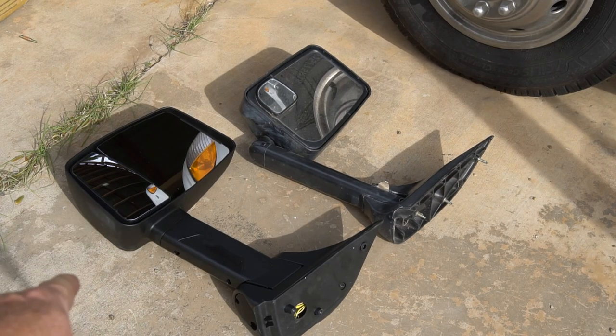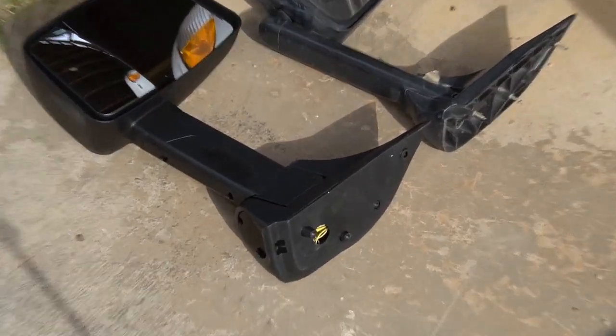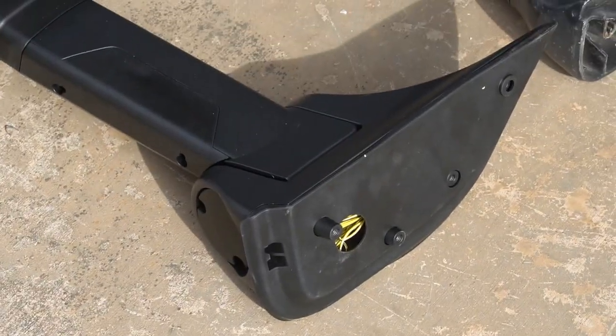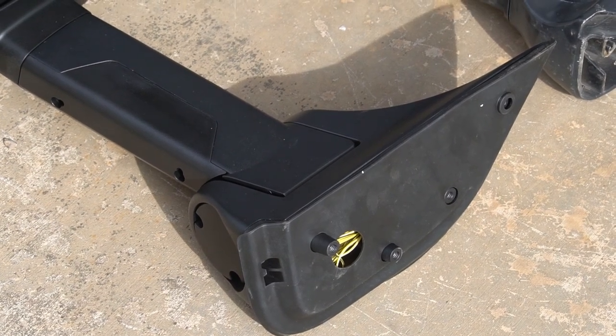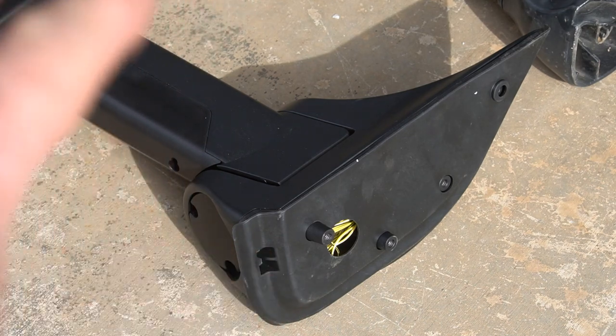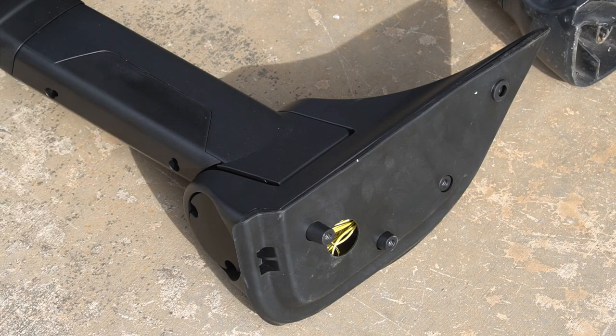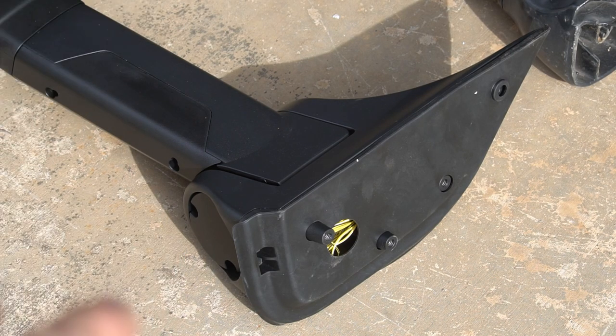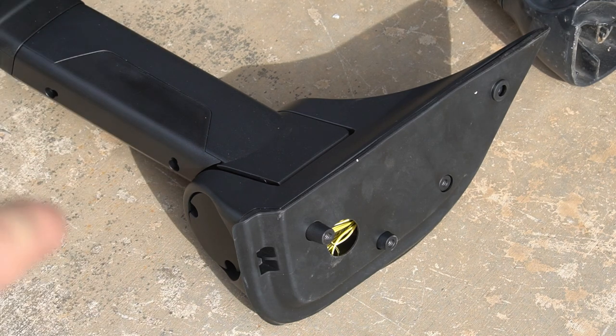We have the new CoolView mirror next to the old mirror and we can see it's a nice big mirror — actually bigger than the original one. It's going to go on nice except for one problem. The stud posts are different than on the original, which are just bolts that stick through. These have a little raised stud area on the stud bolt, and that's going to present a problem. We're going to need some modification to put these mirrors on this Mini Winnie. I looked for days trying to find a replacement set and these were listed as the right ones, but they obviously are not. Those are custom mirrors made by Velvac and you just can't buy them anymore at any reasonable price. So I'm going to modify this new CoolView mirror to fit — it's going to fit perfectly and look great.